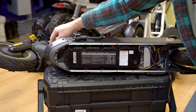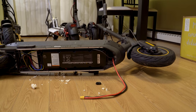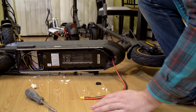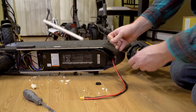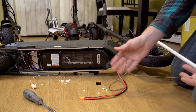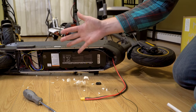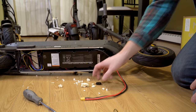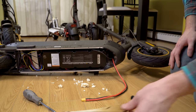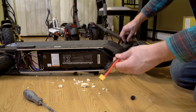About six inches up in the neck of the scooter I see some more foam. I'm not going to lie — that was kind of annoying to remove. I really hope future kits include a tool to help with this, because my screwdriver wasn't long enough. None of the tools I had were long enough. So I had to sacrifice a coat hanger, bent it into a little hook, and repeatedly jammed it up into the hole to hook bits of foam and pull it out piece by piece. One other thing you can try is jamming a spatula up through the foam. But I hope future kits include a proper tool for that, because it's far from plug and play.